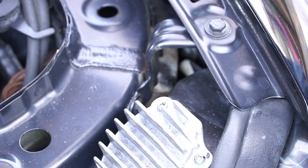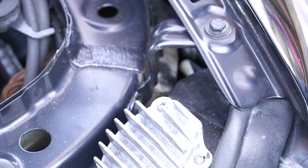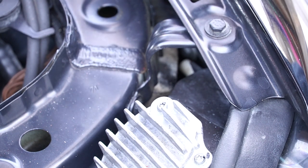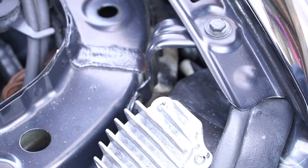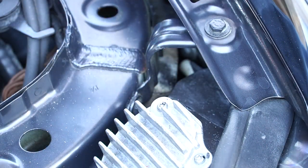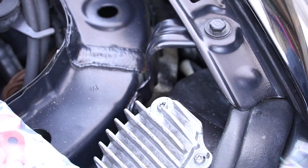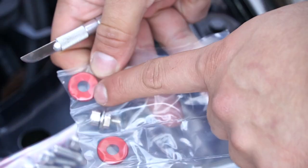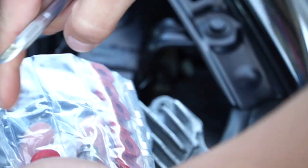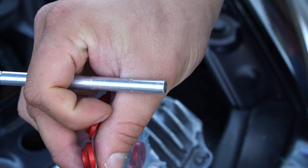Let's go ahead and start. In these instructions, the first set of bolts is for an electrical junction right next to the left-hand strut tower. The thing is, the F22 doesn't have that, so we're going to skip right over those. The next ones we're going to put on are the fender supports — these little guys right here along the sides. They're kind of hard to get to, but if you have a few wrenches you'll be fine. We're going to go ahead and cut these out and move them out of the way — we don't need to use these.